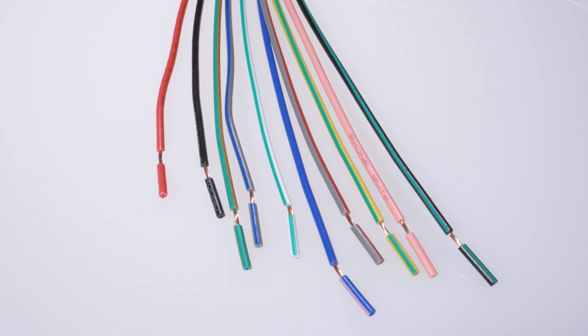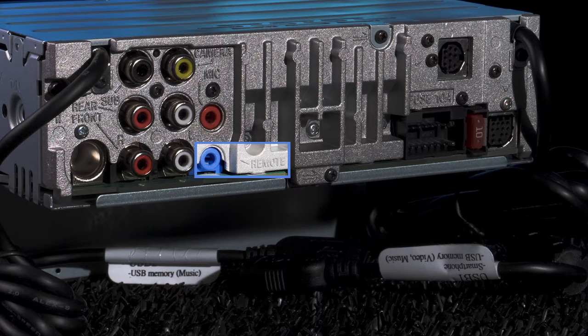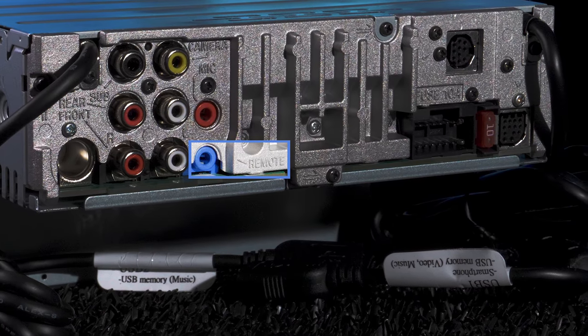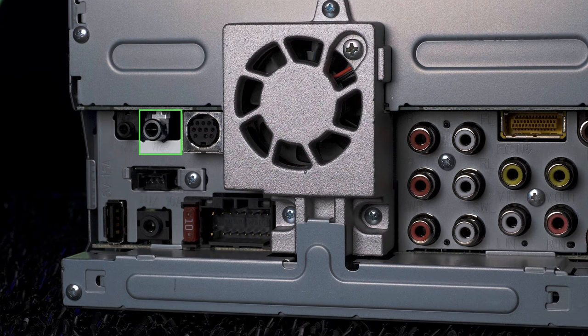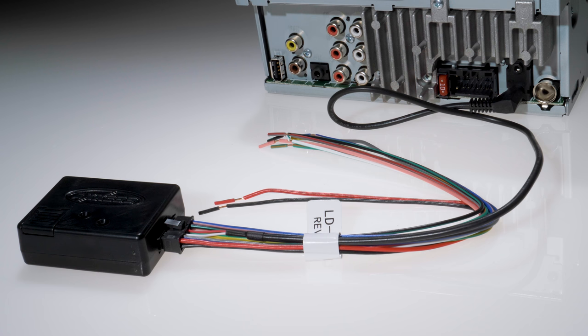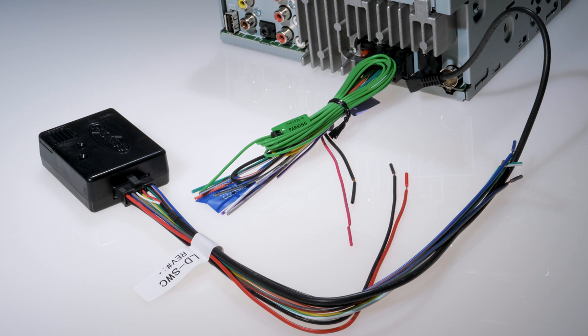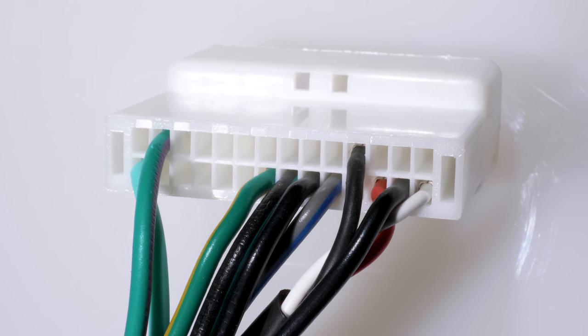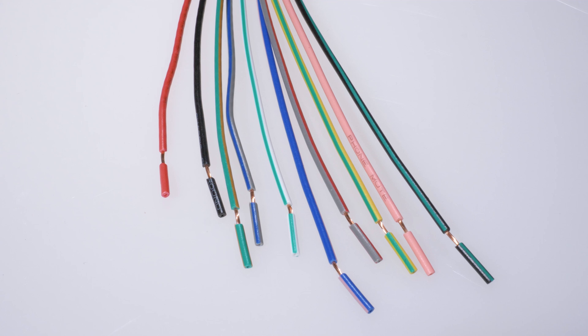For this reason the harness contains a 12-pin harness, but the majority of you will only use just a few wires on it based on the specifics of your vehicle. Most aftermarket stereos have a 3.5mm jack for steering wheel control, so that connection is straightforward — plug the 3.5mm connector into the jack on the back of your new stereo. Next, connect the red wire to accessory and black to ground to provide power to the interface.